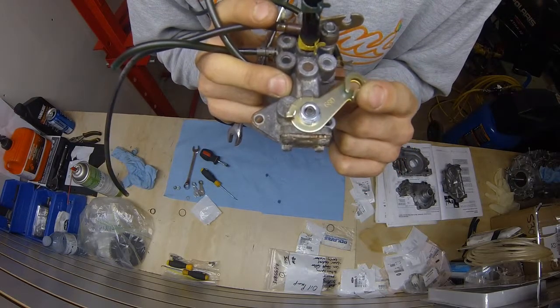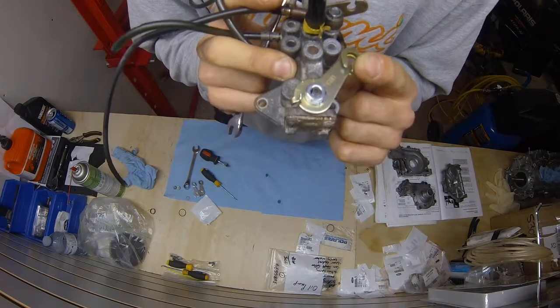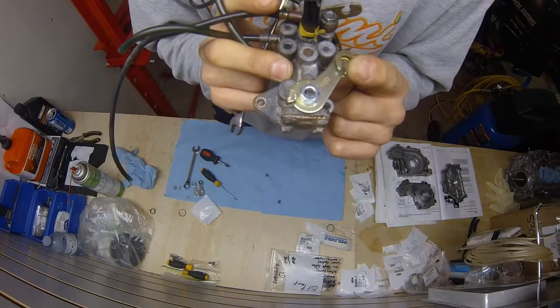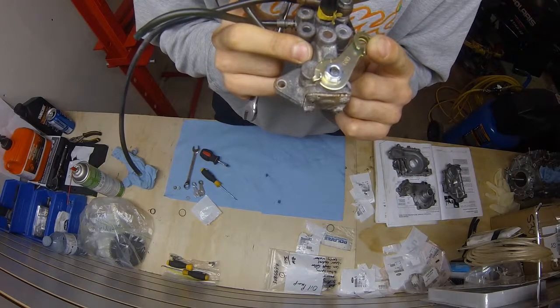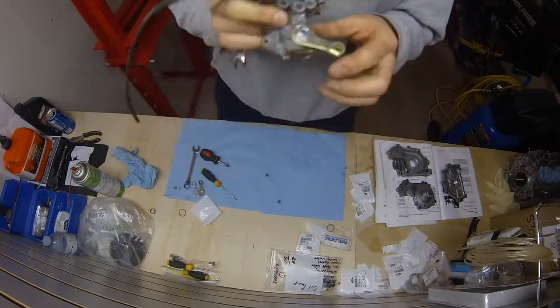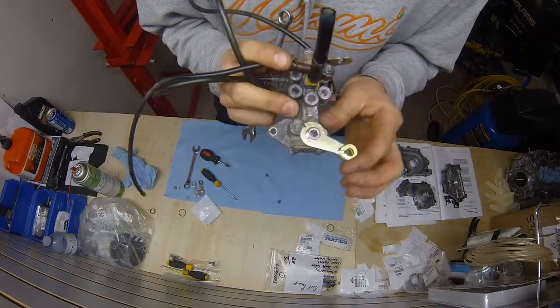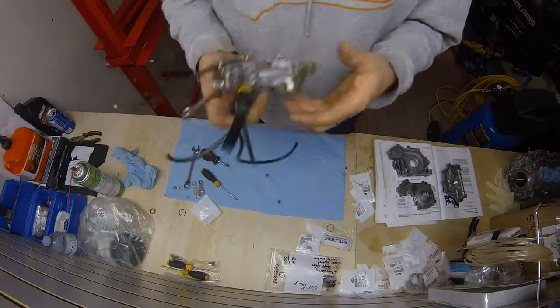If it's below that, well, you're not giving it enough oil, and if it's above that, you're giving it more oil. These old 2-stroke motors, they're not like the new ones with the high electronics, so you have to kind of maintenance it and make sure, because cables wear, and being able to check this and go through the adjustment is important. Making sure everything's good.